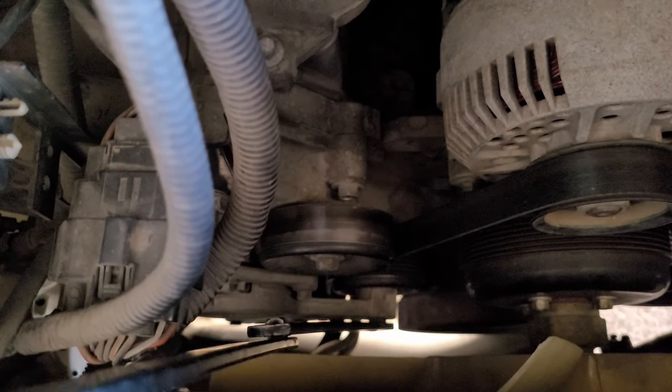The other clips are up under here — let me see if I can get them. There's one there, and back a little further the other one is right there. Remove those three clips. Shroud's out — didn't break any clips. One of the things I like to do is lay out all my parts in an area separate from everything else, so as I start to put the car back together, when I'm out of parts I'm done. Also, wear safety glasses when you go under there because everything will go straight into your eye.